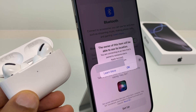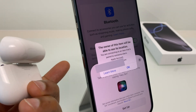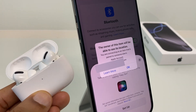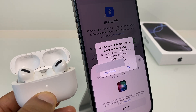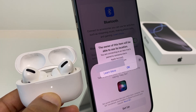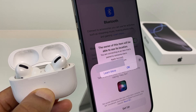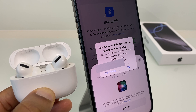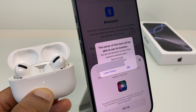So to clear this, what we need to do is reset the AirPods. Just at the back of these AirPods there's a button. Keep the lid open and press and hold the button. As you can see I have the button depressed and the light at the front is flashing. Keep your finger on the button — it flashes orange — and now we know these AirPods are reset.